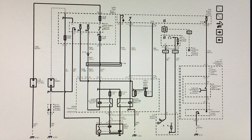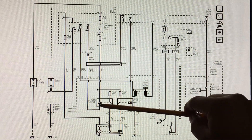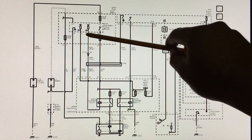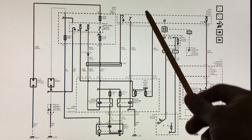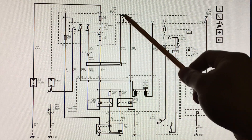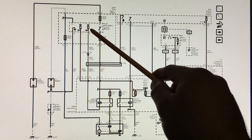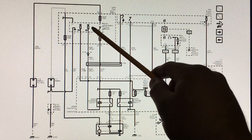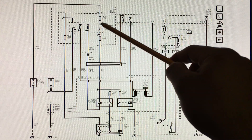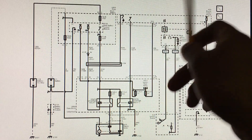There is a splice in this wire that goes over to the ECM, and this is what controls the starter relay. I believe this is how the dual battery control module knows when the starter is being engaged. When you turn the ignition on — not to the crank position, just key on — there's a power feed that goes through the coil winding of the relay, comes back up to pin two at the dual battery control module, and the module sees full system voltage. When the key is turned to the crank position and the ECM grounds the control side of the relay, it brings the voltage of this entire control circuit down to zero — and that is how the module knows the starter is being engaged.